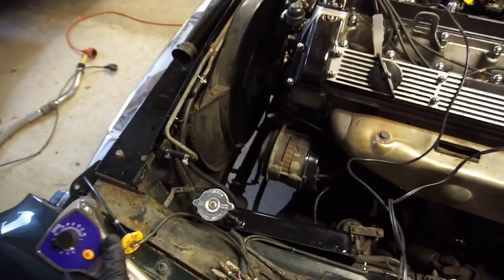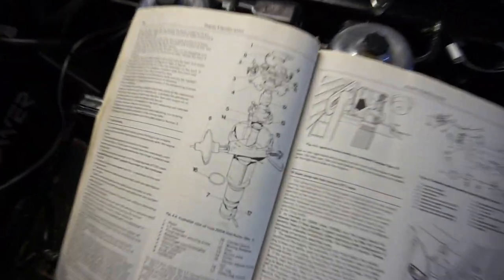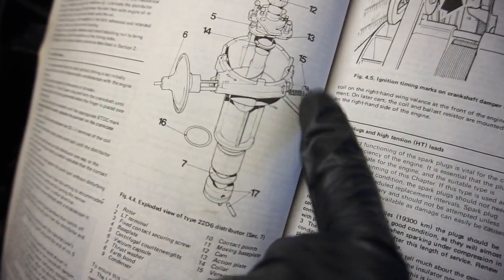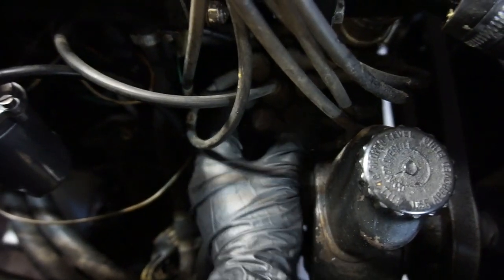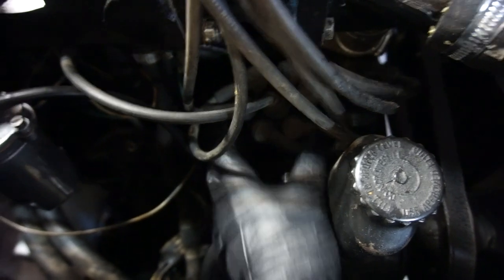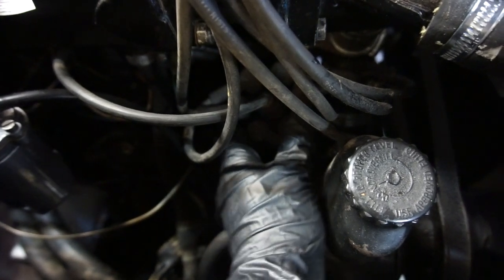I'm going to shut off the engine now and show you what you would have to do if you need to adjust your timing. I grabbed the manual so you can more easily see what that little screw looks like. If you have the earlier distributor, you have that screw there to finely set the timing. But if you have a Series 3 engine like me, you can't do that. Instead, on the back of the distributor there's a little bolt — you can loosen that and turn the distributor back and forth. The rotor turns anti-clockwise. So if you want to advance the timing, you turn the distributor clockwise. If you want to retard the timing, you turn it anti-clockwise.